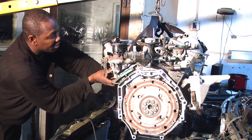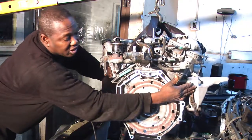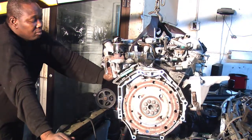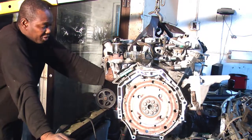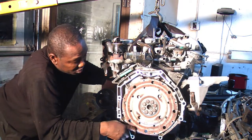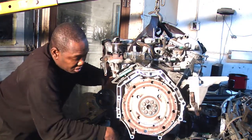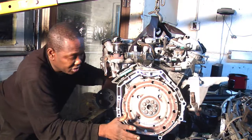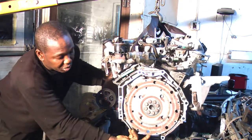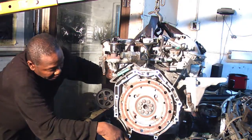Take out the exhaust and then remove the exhaust manifold on both sides — since it's a V6 there's one manifold at the back and one at the front. Remove both manifolds so you have enough space and the job is easier. There are eight bolts on the flywheel that bolt onto the torque converter — it's very important to remove those first. Once all bolts are out, push your finger in there and turn the torque converter to access all the bolts.